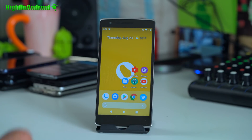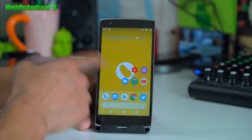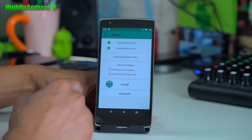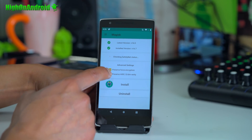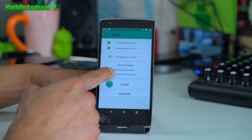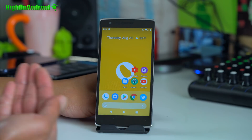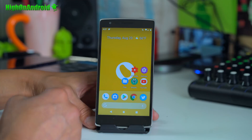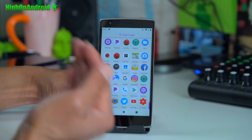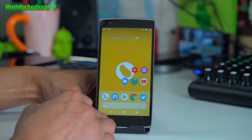It does come with an AOSP launcher, but you can fix that by installing the Android P launcher — I just simply installed the APK over it. You can also root it if you want; I've got it rooted. SafetyNet does not pass, unfortunately — I'm not sure if that's the SafetyNet servers, but this has been happening on all of my older phones lately. Root works fine though. You don't have to install root — it doesn't actually come with root. If you want root, you'll have to flash Magisk and then install Magisk Manager APK after rebooting. The AnTuTu benchmark proved to be much faster than older Androids.